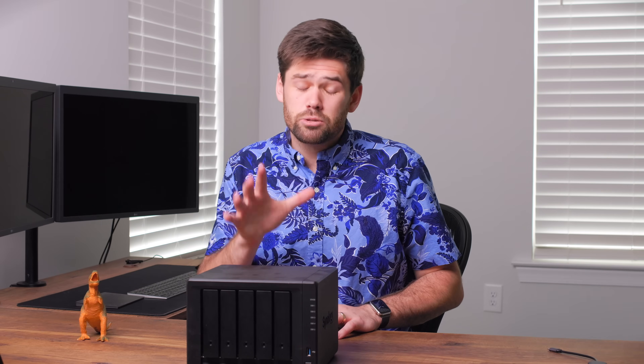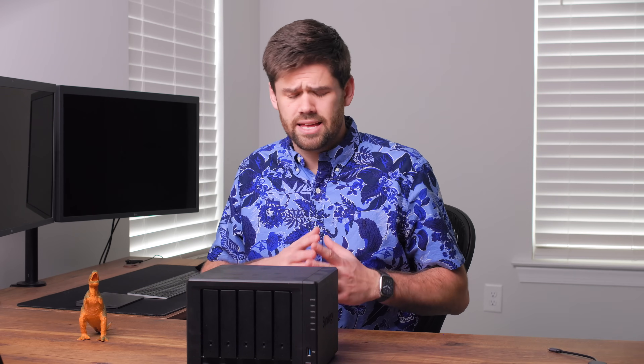You should also really look at 2.5 gig equipment. Maybe you connect your NAS via 10 gig to the switch, but clients who don't need that much performance get 2.5 gig — little adapters that are pretty cheap and an overall better experience in a lot of cases. If you've only got four or five hard drives, you're really not leaving that much performance on the table by going 2.5 gig, since 2.5 gig gives you about 300 megabytes per second, which is close to the max speed of four drives in a RAID 5 array.